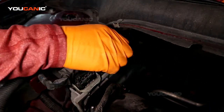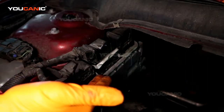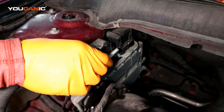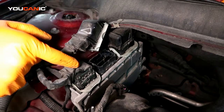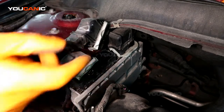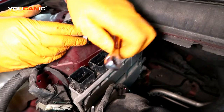These two you can pop off without moving this. The third one you need to move the ECU this way after you undo the bolts. You've got to pop this middle one off first to be able to get this one off, otherwise it hits on the connector there. So we just pop those and kind of move them to the side.